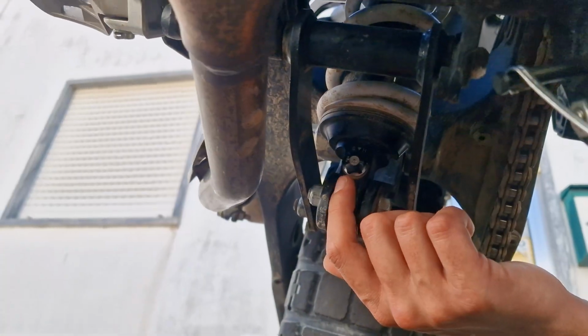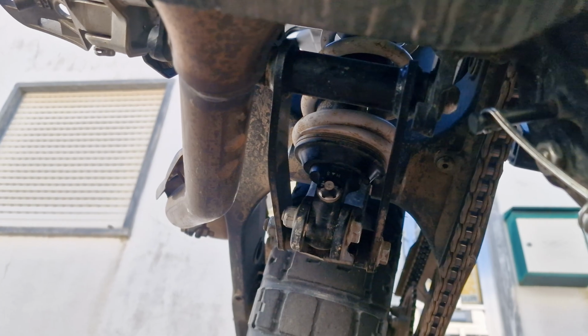And a little note about this. So right now I have reasons to believe that the rebound damping adjustment on the shock is also controlling the compression. It's not supposed to, but whenever I click it and I play with it, I feel way more change on the compression of the rear shock than on the rebound. It's just something that I feel is happening. That's the reason why right now my rebound damping setup is zero. It's 0 turns, it's completely open. Not because I don't want rebound damping, but because I feel that the compression damping also went down. And because I'm trying to make the bike feel soft, then low compression is the way to go. Most times.